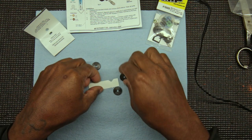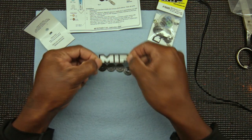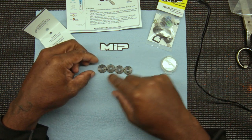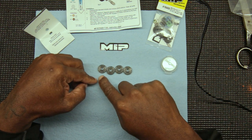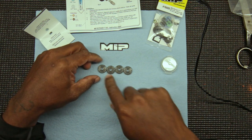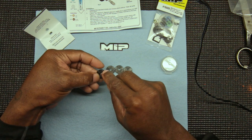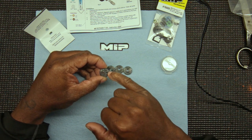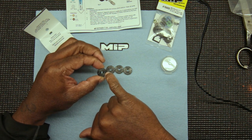So you're going to get four pistons for your shocks, plus a MIP sticker. I have the six hole version — they also have an eight hole — and each hole is 1.3 millimeters. The three holes here control the valve, so they control your pack and your rebound.